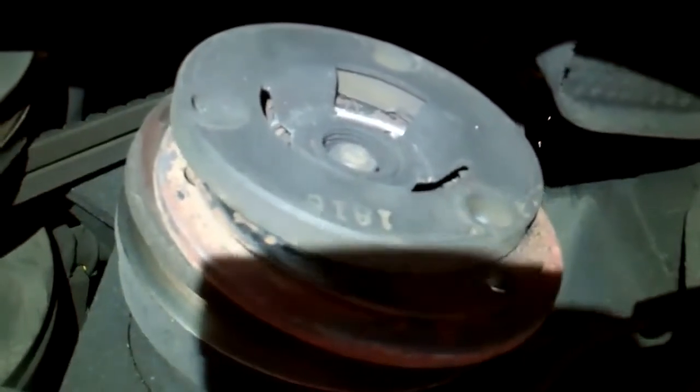We determined that you need a new AC compressor. This compressor is old, and if we just try to change the clutch on these compressors, what happens is the compressor starts to leak oil within a few months, possibly at the front seal. So we're recommending replacing the whole compressor and putting a new unit on. New units generally last 5-7 years, whereas rebuilt units only last 1-3 years.